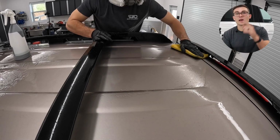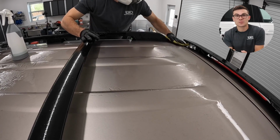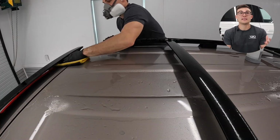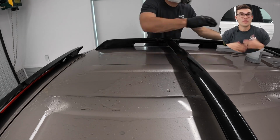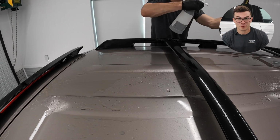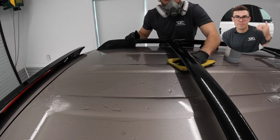The aerosol can Citral Degreaser tends to be a better product for that specific area where you can actually spray it, leave it, watch it start to melt it off the paint, pressure wash it off, and you don't even have to touch it with any microfiber towel or with your hands or chip at it with your fingernail. Really powerful. And those are the 2 ways I use this product and the 2 ways I buy this product.